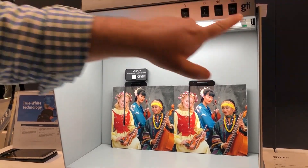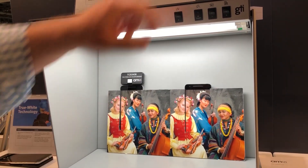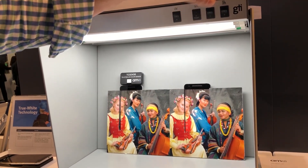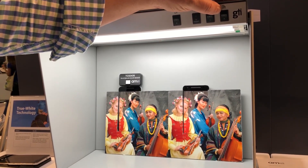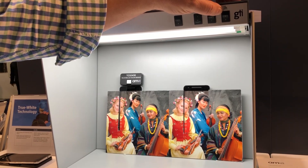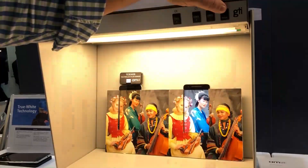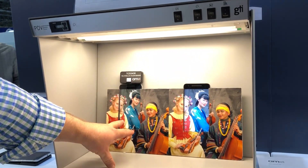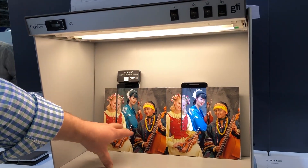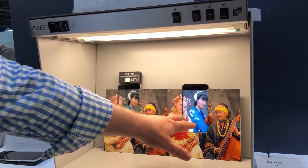This cabin is currently illuminated at 6500 Kelvin. If we switch to a warmer color temperature that might be found in an office environment — say fluorescent lighting at 3000 Kelvin — and turn that on, you can see how the white point on the display on the left has adjusted, whereas the smartphone without the color sensor did not adjust.